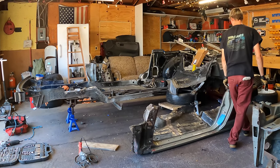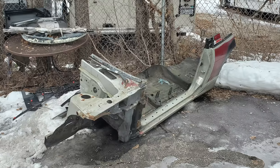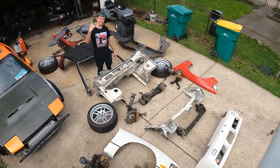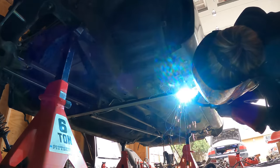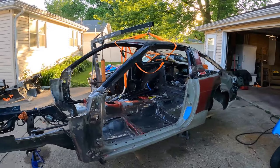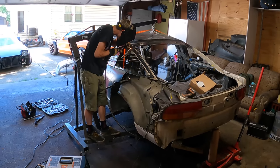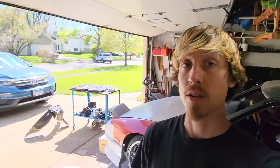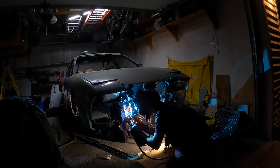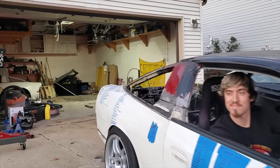The only thing left on the car was the driver's side right-hand-drive quarter panel and the rear tail light skin. I collected parts out of part-out cars — the roof, the whole left side of a car, core support, shock towers, and firewall. Once I got all the parts I made a jig out of straight S13s and put the jigs on my car so I knew where to align the new parts. I trimmed the new parts to fit, learned how the structures work, tack welded the car together, then welded it enough to be a roller. We towed it to my mom's house, continued welding the rest of the car, made tubs in the engine bay, fixed the RB25, dropped it in, and had the very first test drive last fall.